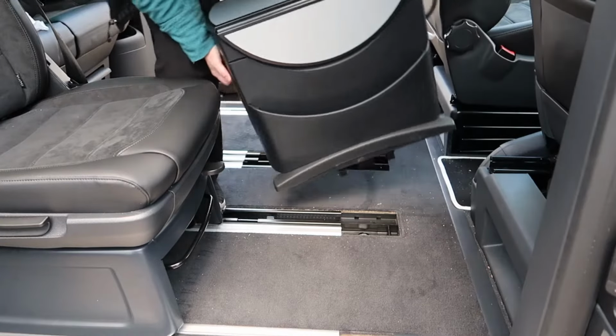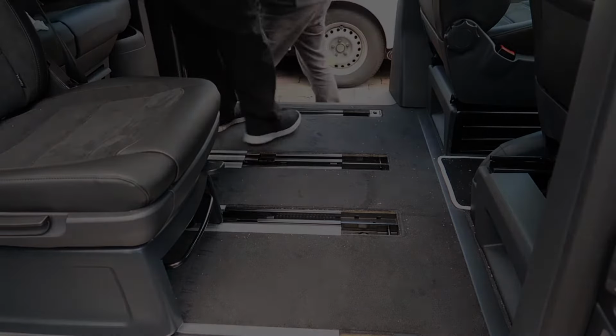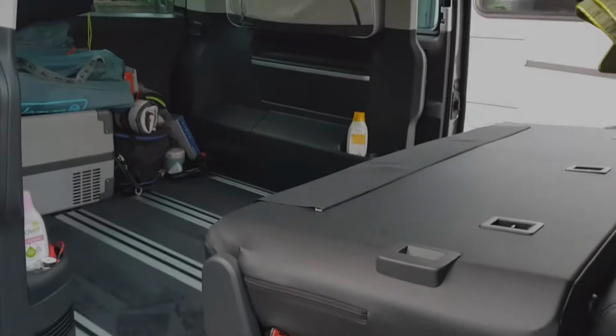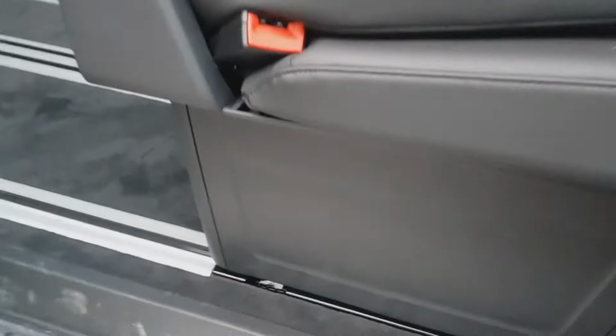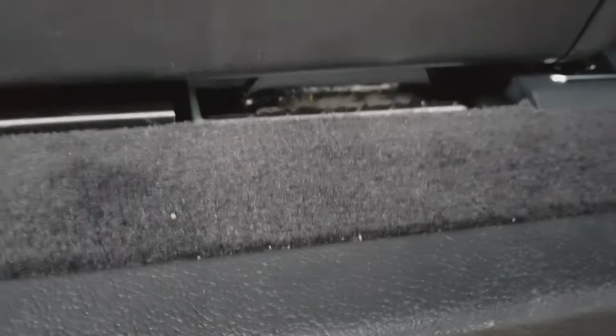And then once the individual chairs and the table are out, you can pull the positioning strap of the three-seater bench. So that's the strap underneath rather than the lever that you use to fold it. You will have already folded it using the lever that's slightly higher on the seat. So slide that all the way towards the front, and you can see it's exactly the same principle. So the feet line up with the slots that are now available in the rails that are usually covered by the aluminium cover pieces. I'll show you a close-up of the wheels that each seat actually runs along in a minute.